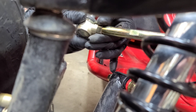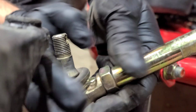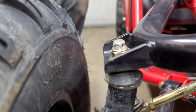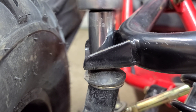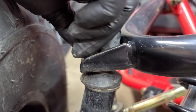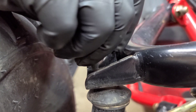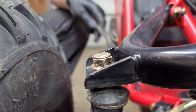None of this was tight. In order to get that to go in there, this top nut has to be loose — I believe that's 17 millimeter. See, that wasn't even tight. The only reason you're loosening this is to give you a little bit more flexibility in your spindle to get that tie rod end in there from the bottom. Then you'll have to realign the go-kart the best you can and go from there.